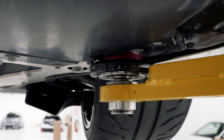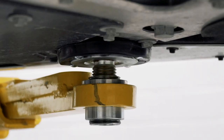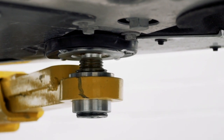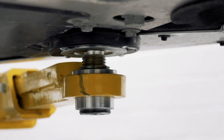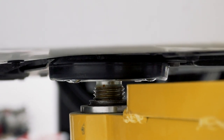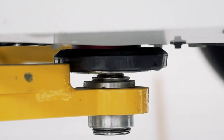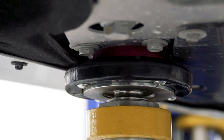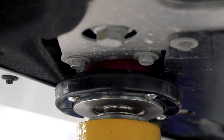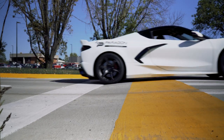Once on the lift, the puck creates a buffer between the pad and your car. Without the puck, it's harder for the tech to align because the lift pads are so big — they can still come into contact with the body, an undertray, or miss the jack point entirely. The puck gives a nice centering spot and is just tall enough that you won't run into the body or side skirt. We also designed it at a thickness where you can leave it on the car and not worry about hitting a speed bump — if the puck hits a speed bump, you've more than bottomed out the entire car.